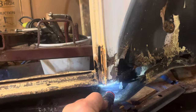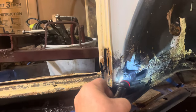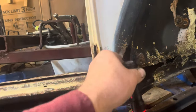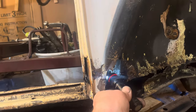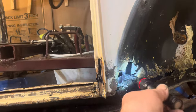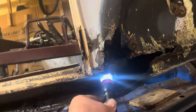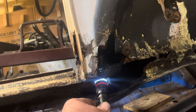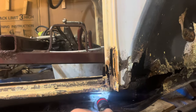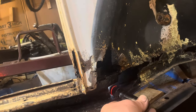What I did is I rolled a piece of steel around a socket and tack welded it, then I cut an oblong circle out that this fit right into really nice. I made it so it was really tight in there and I had to take a bar of steel over it and hammer it down in there. I hammered it into this piece and tack welded it, then tacked it onto this piece here.